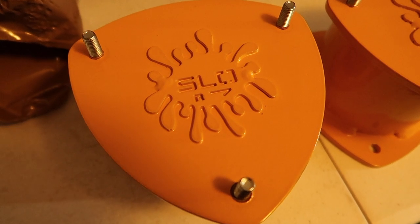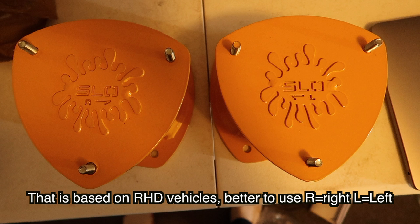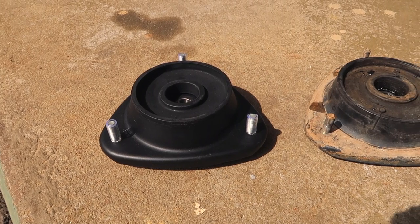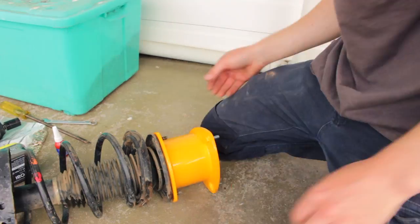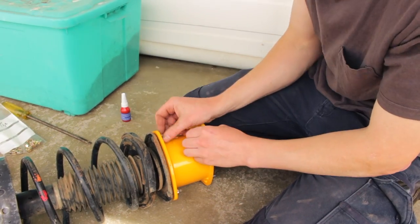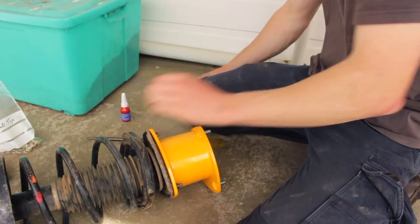Now we can move on to the strut top spacers. Take note that the strut top spacers have an R and L with arrows on them - R represents the driver's side and L represents the passenger's side. When fitting, the arrow should point inwards towards the transmission. While I was at it I replaced the strut top hat as the old ones were worn - this is not a step in the installation but while the strut was out I figured I may as well replace them. Tighten all strut top spacer nuts and remember to use thread lock. I found using a long screwdriver jammed between the strut top studs was useful to stop the strut moving while tightening.